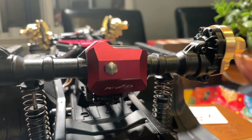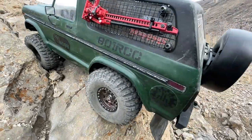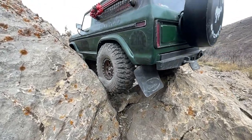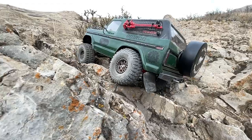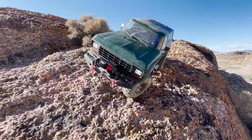Just a reminder: if you do add this much brass to your truck, you're going to be changing out a whole lot of other stuff as well. Electronics out of the box on any truck generally aren't going to be able to handle adding this much weight, so that means you're going to be spending a decent amount of money on an upgraded motor and ESC. On top of that, to handle side hilling at all once you add this much weight, you're definitely going to be looking at upgrading tires and putting upgraded tire foams inside those tires so that you're not dealing with a ton of tire rollover.